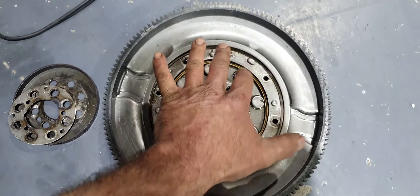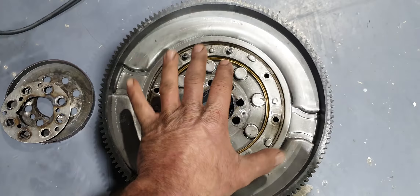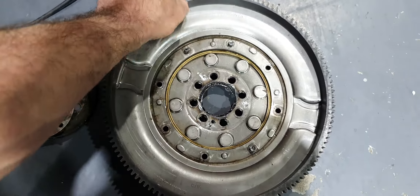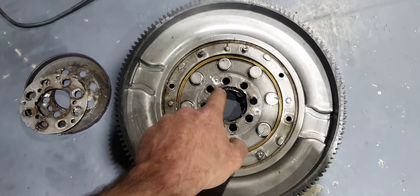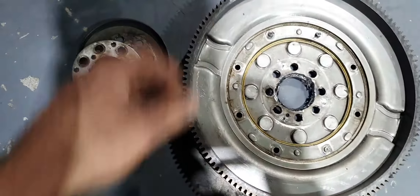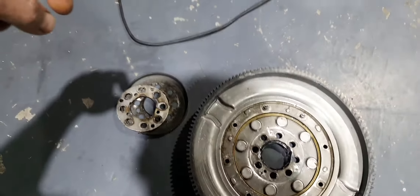Because the dual-mass flywheel was wobbling, it ended up like a friction weld. Because it was so tight — the clearance — it's not been designed to rub the flywheel on the crankshaft like that. That's why you see the hot spot, and it turned up like it will start welding together with the crankshaft. Fortunately, it didn't get welded. Otherwise it was going to be worse for me to take it out.